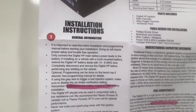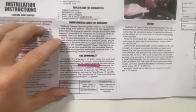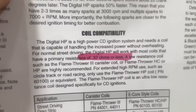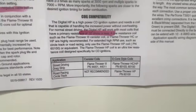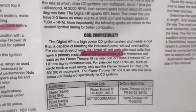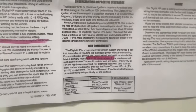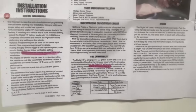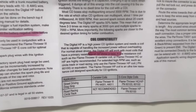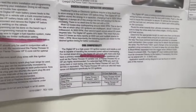Reading through the directions, I just wanted to point out a few things to note. Obviously, unhooking your battery is pretty common practice. They recommend a coil that's 0.32 ohms or less, and then they recommend their own coils, obviously. You'll find that most coils don't have a primary resistance of 0.32 ohms or less, though I have found other versions of this paperwork that say under 3 ohms. So take that for what it's worth — make your own call on that. My coil is 0.7 ohms and I'm going to run with it, because there's other paperwork that says under 3 ohms.